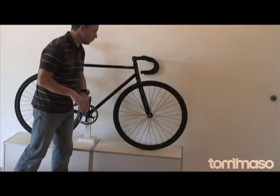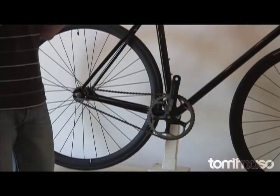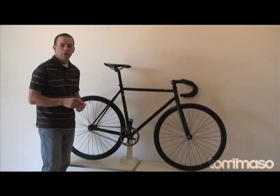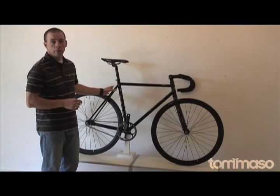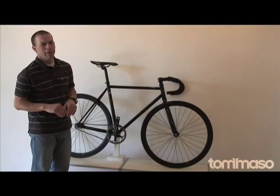Very strong alloy wheels, 32 spoke front and rear. Another nice touch is the flip-flop hub — that means if I decide I would like to coast instead of pedaling all the time, I can install a BMX style 16 or 18 tooth freewheel and then I'm allowed to coast. Of course, if you're going to use a freewheel on the hub instead of a fixed gear, you are definitely going to want to have brake calipers installed. With a fixed gear you can actually slow down your pedaling or almost skid to come to a stop, so having the brake calipers is probably a good idea to get started.